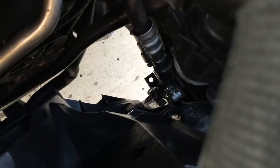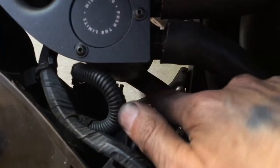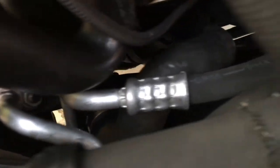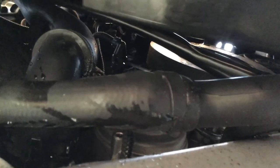Other than that, everything fit. As I said, if you've got a convertible, this strut rod right here runs through — you can't even see where it goes. It goes there, then underneath and across the front of the motor. When you look up through the fan you can see it right there. If you have a convertible it's best to leave that brace off, because you won't be able to get anything in or out while it's in there.